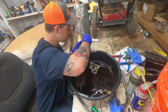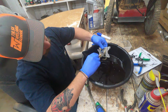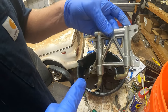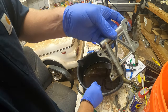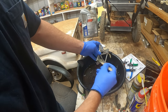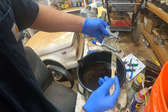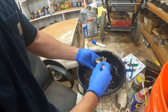If you haven't watched my other two videos on removing the carburetor and disassembling it, I would watch those because they do provide some tips and tricks on what to do and what not to do. As you can see, there's a difference — on the right is the part I've lightly touched with the paint brush, and the part on the left I haven't. Gasoline is a solvent and it is dissolving the grease, dirt, and grime. All the metal pieces are here with all the rubbers removed — everything is safe for gasoline to touch.